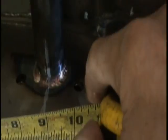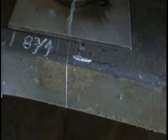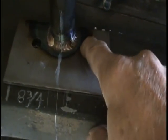That's the center line of your shock bar. Measure the same thing on both sides. Put the center line of the shock bar there. Clamp it in, slide it as far as it'll go upwards against the top of the frame rail. Clamp it in place and drill your holes. We'll do that procedure next.